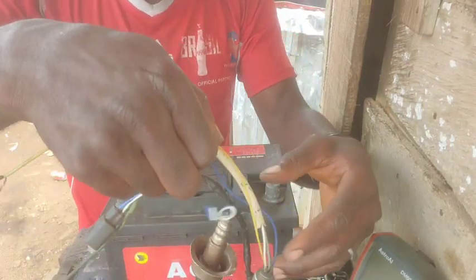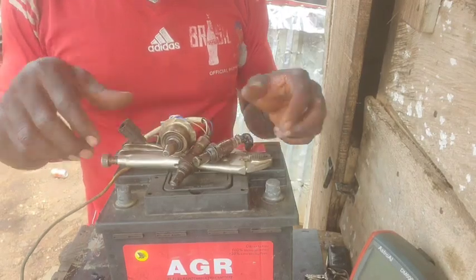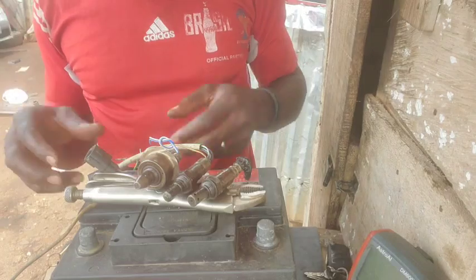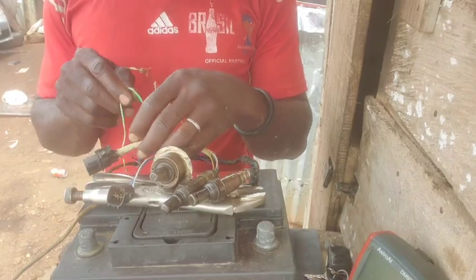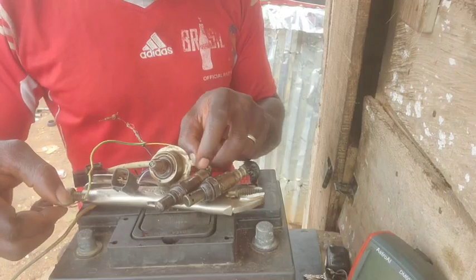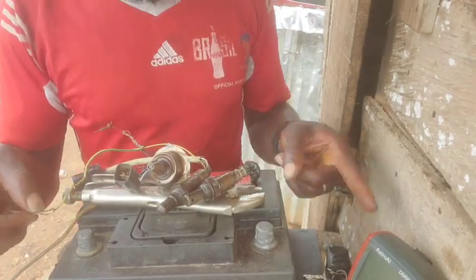With that information, you can evaluate most bypass videos out there. The 10K ohm resistor will never fix the amperage issue. The ECM also monitors how much power the O2 sensor pulls from it — that power comes directly from the ECM. When the heater circuit short-circuits, there is a real risk of ruining your ECM. I have seen this happen on Mazdas and other makes and models.